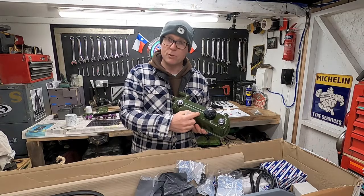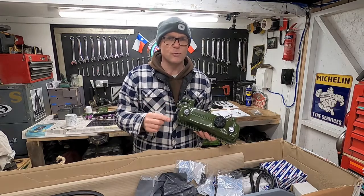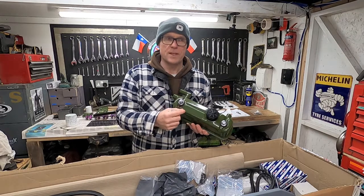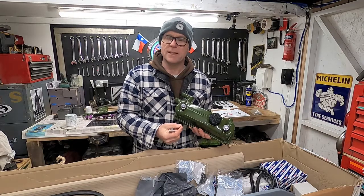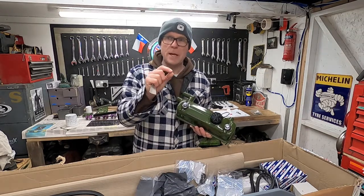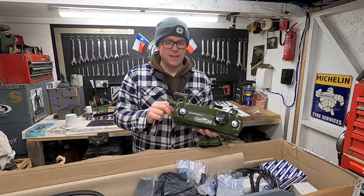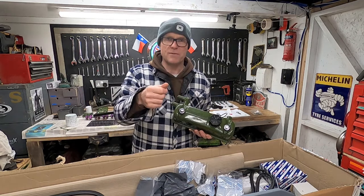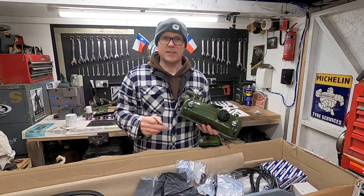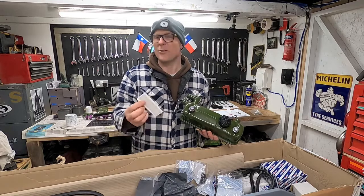Now I have got the aluminium plates, the ones that you rivet on. Someone pointed out that you can't just use a normal rivet — it has the pin that you pull to squidge it, which snaps off and leaves a little stub in the hole. If through vibration, time, heat or anything, that little stub of the pin in the middle of your pop rivet falls out, it's going to fall into your engine and cause an awful lot of carnage. So you have to punch that pin out and fill it with a metal fillet to stop that from happening. I do like the look of the steel, but I don't want to risk stuff ending up in the engine. So I've decided to go for stickers. Looks like I've ordered the wrong sticker — never mind.